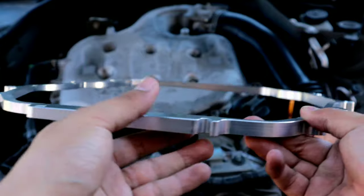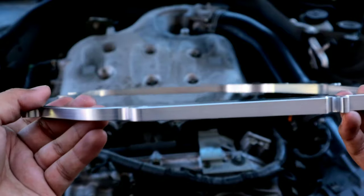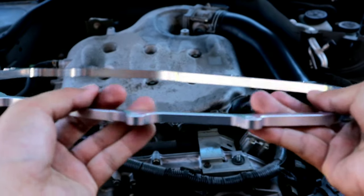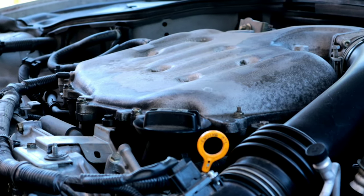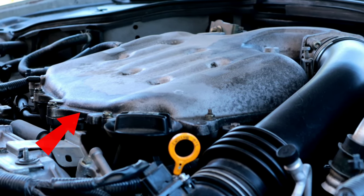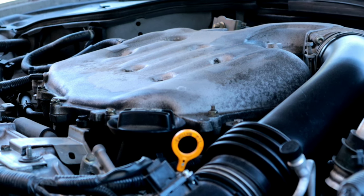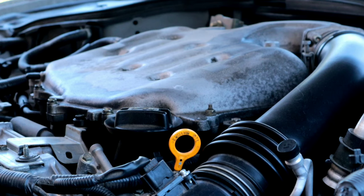That's a little bit different from your standard one-size plenum spacers. I haven't really found a legitimate answer to whether an angled plenum spacer is going to give you better performance over a traditional one-size plenum spacer. Personally, why I believe you guys should go with an angled plenum spacer is because if you look at the stock plenum design, you can see that the front cylinders are not getting as much air as the back. With this plenum spacer it's going to give you more air to those front cylinders that actually really need it, giving you the best of both worlds and overall better performance.